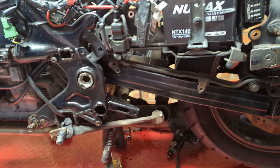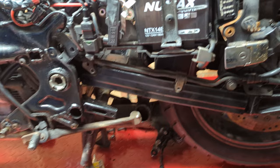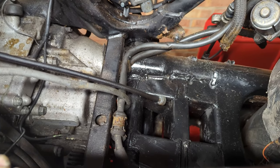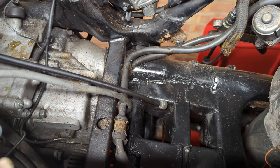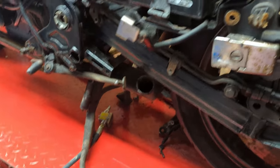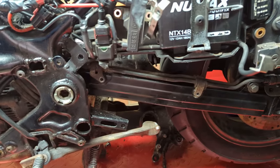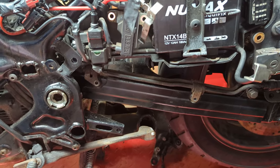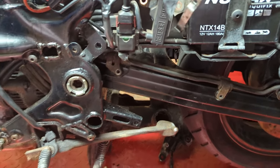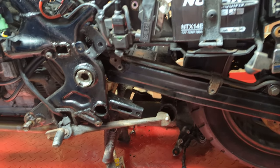It took a long time to arrive, and when it arrived I threw it straight into a bucket of Evapo-Rust and forgot about it for ages. In some footage that I lost because I'm trying out a new camera app, I fixed up any bits and bobs — it was missing some tabs, had a pinhole in the top, just a small hole in the tube that you can see at the top right there. I've fixed up the channel that runs along the other side at the back, which is normally where it collects water and rusts, and drilled a couple of holes in the bottom. Then painted it all back up again, knocked off any rust I could with a flap wheel so it looks almost mint under the paint, and given it about 8 million coats of thick black Hammerite anti-rust paint, and chucked it back on the bike.